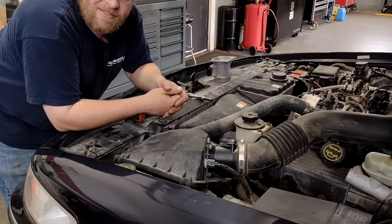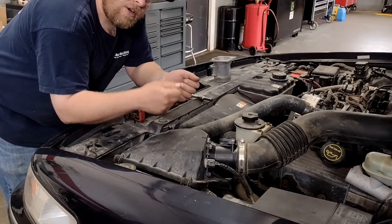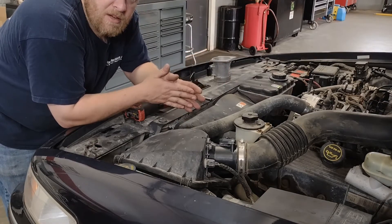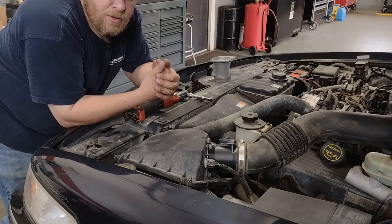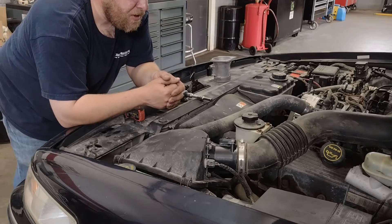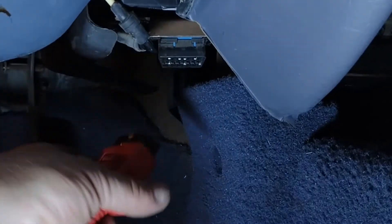Neither method is a difficult task. If you do the battery method, you just want to unhook the cables and let it sit for about 15–20 minutes. You can also do the hard reset procedure where you take the cable off — I typically do the positive cable, stretch it over, give it a second, and then touch it to the negative cable. All you're doing is draining any residual power out of the capacitors in the PCM so it clears that memory. If you use the scan tool — which I'd recommend — or if you don't have access to one, a local automotive shop may be able to help. Typically your normal O'Reilly's, NAPA, or parts store won't have a scan tool capable of this; they just have code readers.